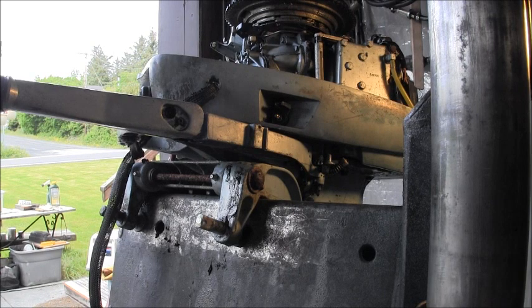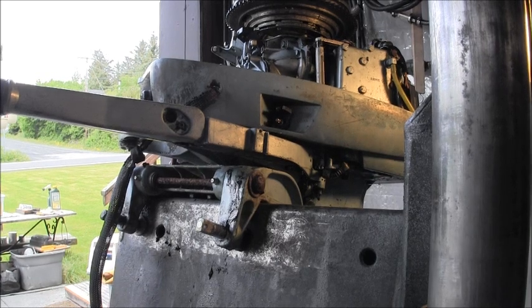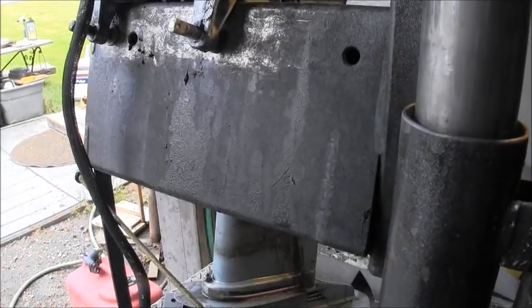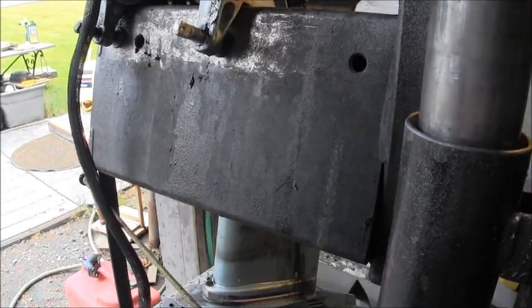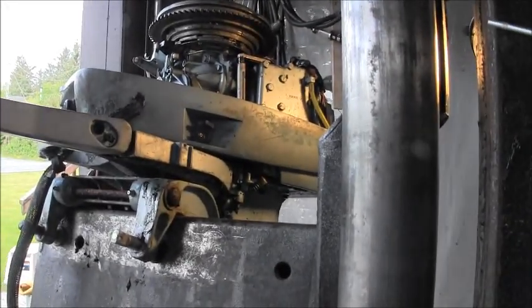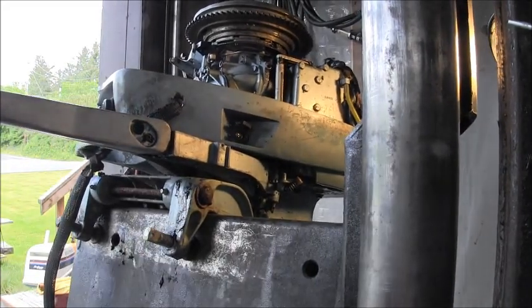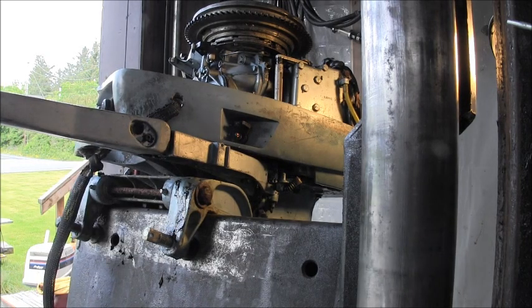And the reason why this engine is not cost effective is because of the overall condition. Even though the power head runs good, I know the fella, he's not gonna wanna spend the kind of money it would take to make this motor right. What I found as I was moving along here, if you look at the lower motor mounts, or lack thereof, the lower motor mounts are broke. The upper motor mounts are either broke or all weak. The transom clamps are froze stuck. I'll get them freed up by drilling some holes.